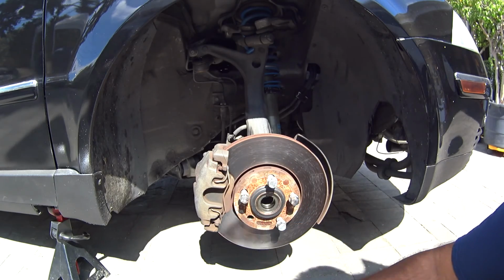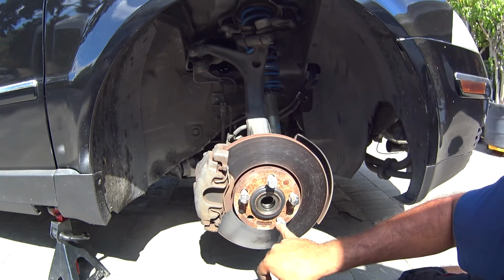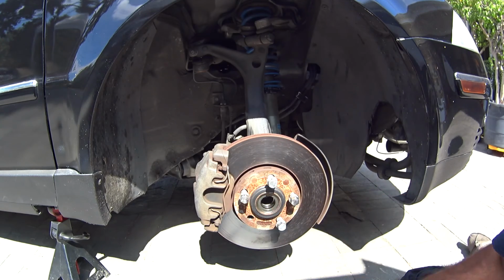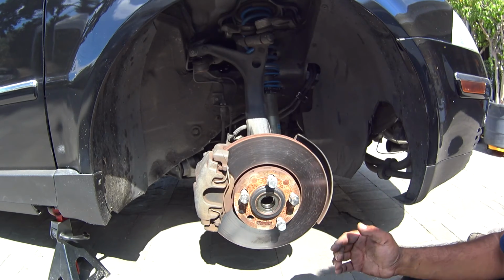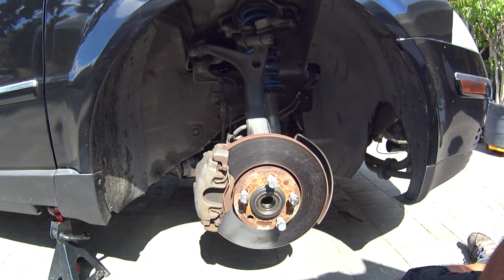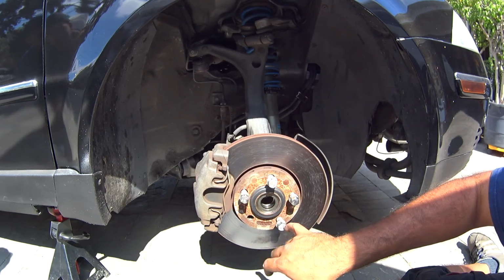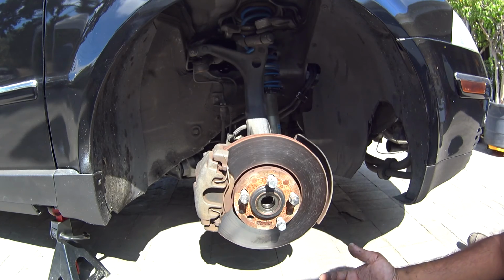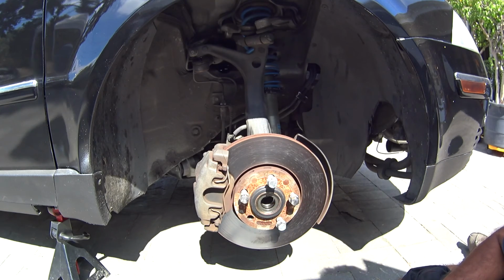Once you do that, take out the bolt. It will shoot grease out of here. There's actually a grease chute that's inside here. The way that they pack the grease on these is a little different than on a Mark IV. They actually get packed in through the threaded port on here. So I would recommend getting a rag or something and cramming it in here, because it'll shoot some grease out and it's going to make a mess. So at least you can catch the mess.